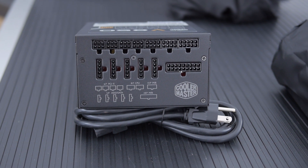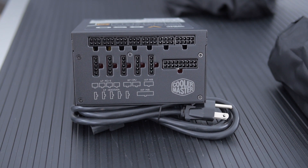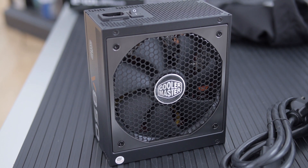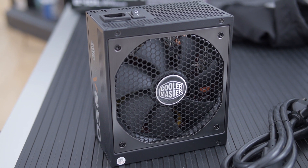I'm not sure how they were able to do as much as they did — fully modular, using the Seasonic platform, good capacitors. They've rated this at 40 degrees Celsius operating temperature, but you should be able to go 45, 46, 47 — maybe even 50 — with this. It should be just fine. So they've been very conservative as far as that goes.